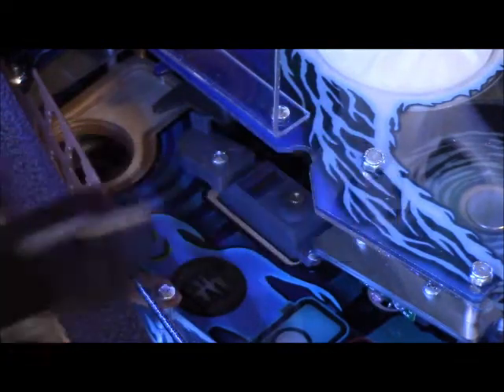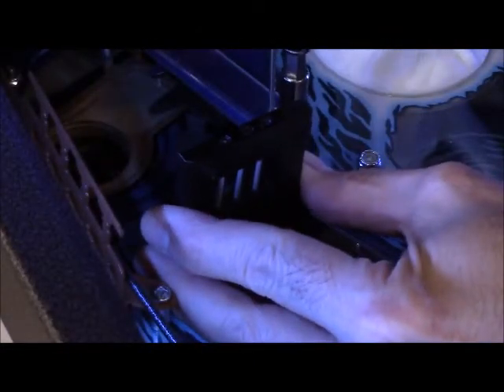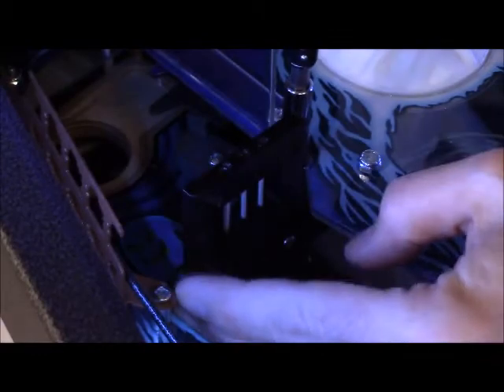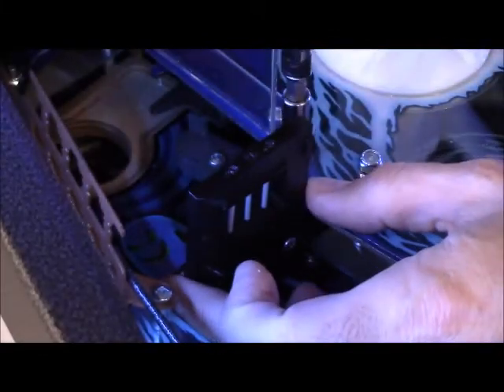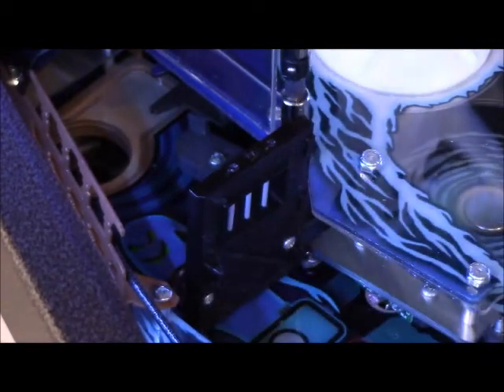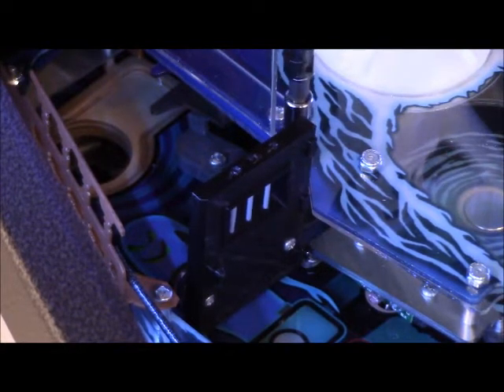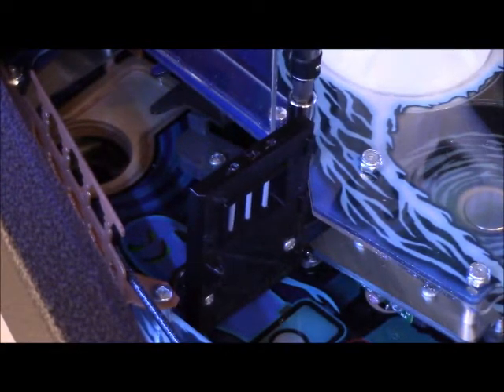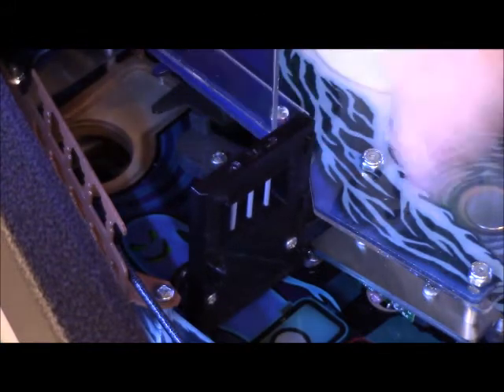Here's your door, here's a screwdriver — it is a single screw. We're going to put the door on. Sorry for blocking this with my hand, I'll get it out of the way as soon as possible, in the closed position. Tighten it down until she's good and snug. Don't over-strip it. Good and tight, and it's not dragging on the playfield.